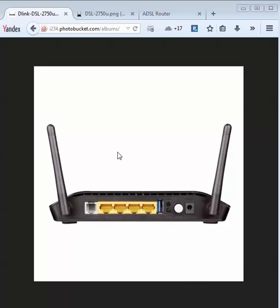So I am going to tell you how to make your 2750U D-Link router a true Ethernet WAN router. The 2750U router is actually capable of both ADSL and Ethernet WAN routing. However, Indian firmware only enables the WAN ADSL. So one needs to use the Middle East (ME) or Russian (NRU) firmware to enable the Ethernet WAN function.